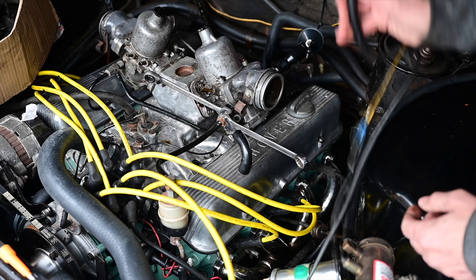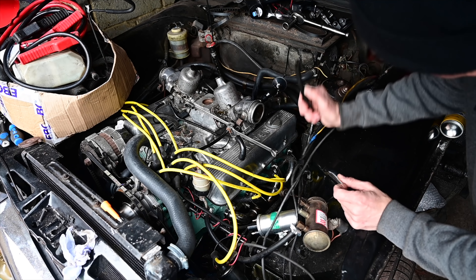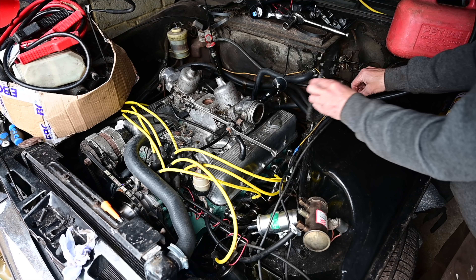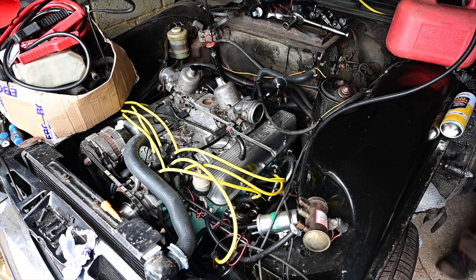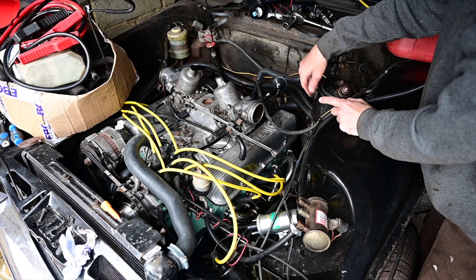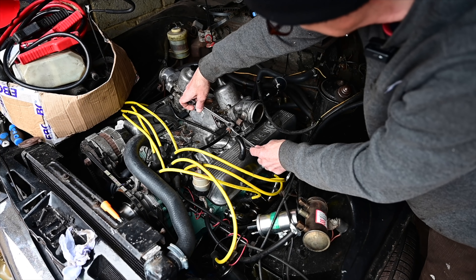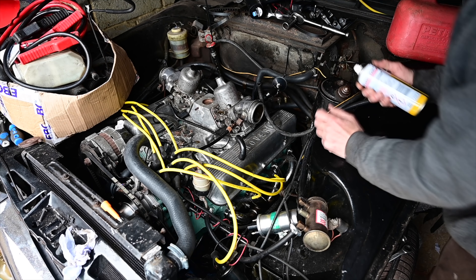That's a lot of petrol on the floor. That was the original feed from the petrol tank - so why on earth is that there? This would have been going into this pipe just here. It seems like fresh petrol. I don't know if that's gravity or air pressure from the return line. Let's see - no, that must just be air pressure from the return line taking that back and pushing it through. Let's slacken this off and see if we've got a leak - oh we have, there is fuel there.